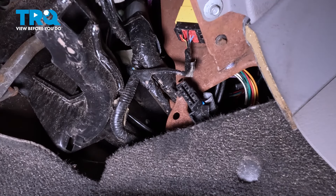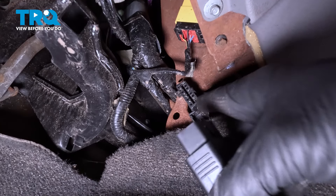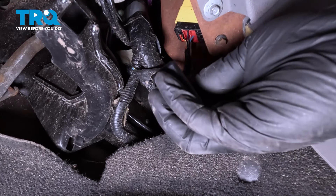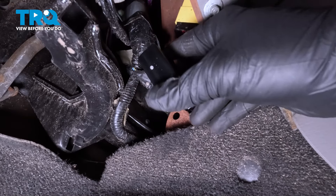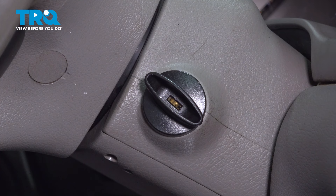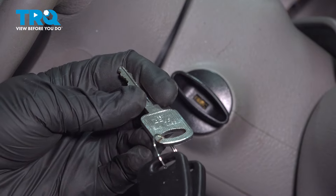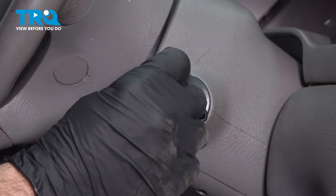With the battery reconnected and the door open, we're going to have the door chime going. Go ahead and take the programmer — up on the driver's side we have the OBD2 port right here. Plug this in and we should see a single beep. We're going to hop in the vehicle and close the door. Once we have that single beep from plugging into the port, we want to insert the non-transponder key — this is our non-transponder key here, and we have the two transponder keys.